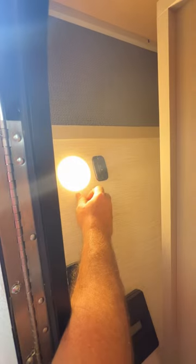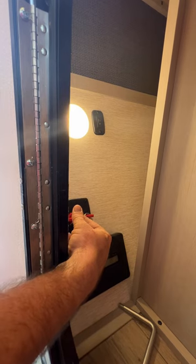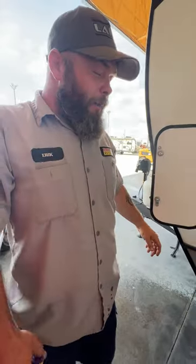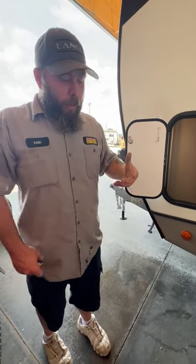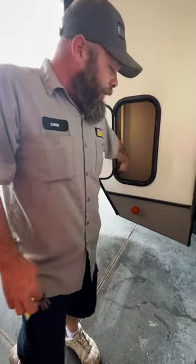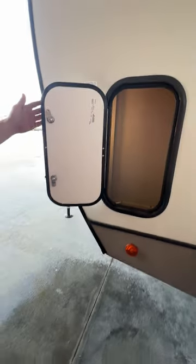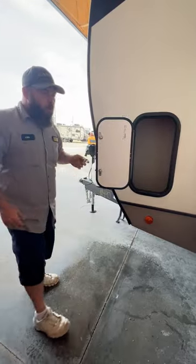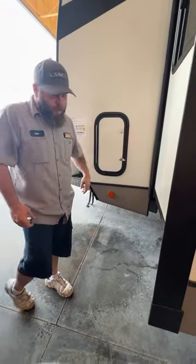The switch for the cap lights is actually going to be located right inside here — there's a switch right up here at the top to turn that on and off, and they do give you a little LED light there as well. Right there is going to be our battery disconnect. When we are storing the camper, we're going to turn this and pull the key out, so anything that was potentially left on would not drain our batteries — especially the fridge. It is a 12-volt style fridge, and if that guy is at full blast, the solar panels do struggle to keep up. This model actually has an off-grid setting so it doesn't pull as much power to stay cool. And the very bottom guy there is just your solar panel controller — it monitors the batteries, and when you're boondock camping, once the batteries get below a certain level, it allows the surge from the panels to charge the battery. Once the batteries are full, it will shut that circuit off so they don't get overcharged.